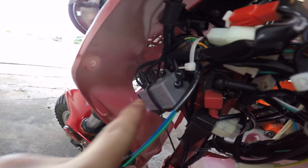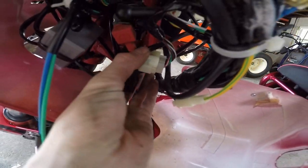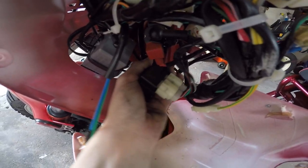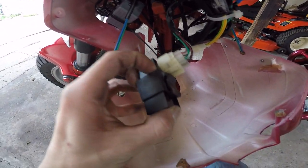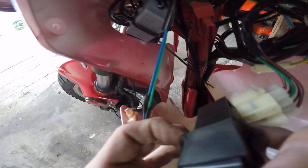You've got the horn back in here, the headlight box, and right here in the bottom left side you've got the CDI. The easiest way to do it is just pull out the whole thing — it's on a rubber mount, just wiggle it a little bit back and forwards, up and down, and pull out the whole CDI box. You're going to want to save the little rubber piece because it'll slide around the new CDI.